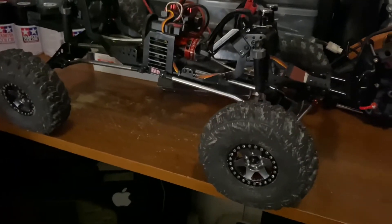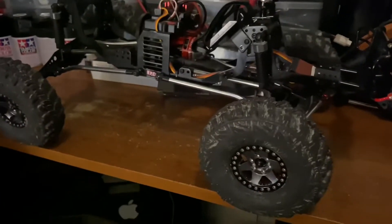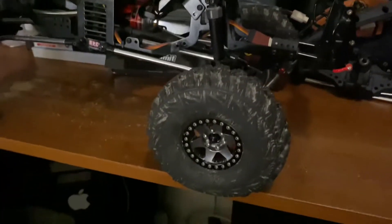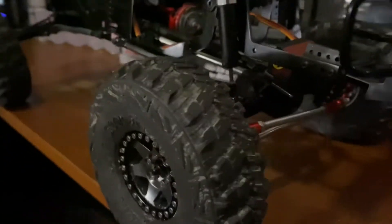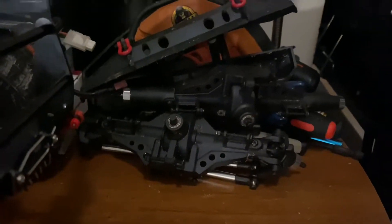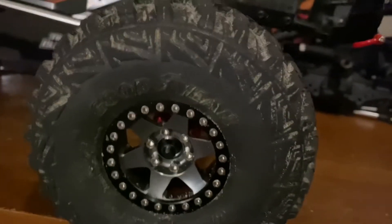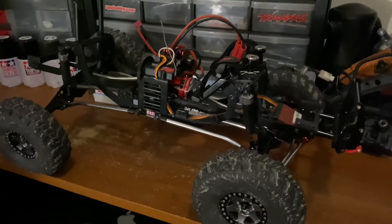Hopefully this is going to be quite the upgrade. It added a lot of weight down low, but it did raise up the center of gravity just a touch with the portals because that lifts it up - that's why I dropped the suspension down. I have the same tires I had before, but they are a little narrow. Because of the portal axles being wider than stock, they do stick out a little on the side so I may have to do some more body trimming. I also have some deep dish wheels I could put on there that would make the tires stick out far enough to clear the body and give it a super wide stance.